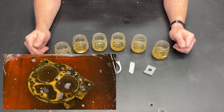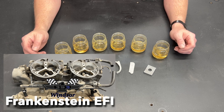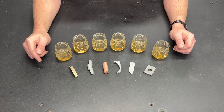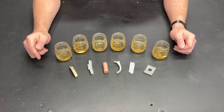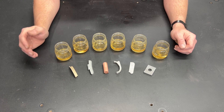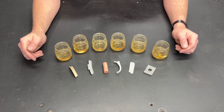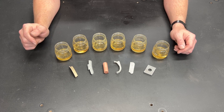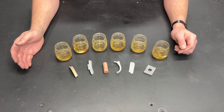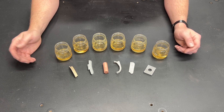I've used Pine Sol to clean the throttle bodies for my Frankenstein EFI project and was very happy with the results. I had a comment on one of my videos where someone said they had put Pine Sol in a galvanized container and after a period of time it started leaking. Upon further inspection they saw that the Pine Sol had actually eaten away all of the zinc and started to rust the container.